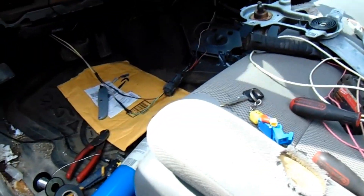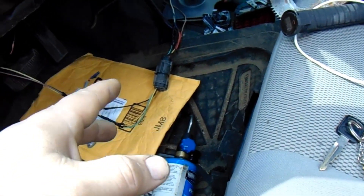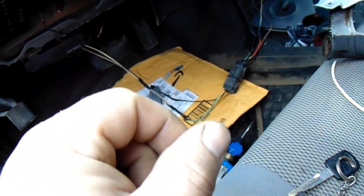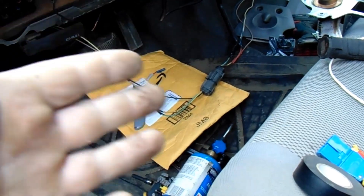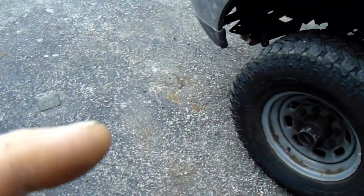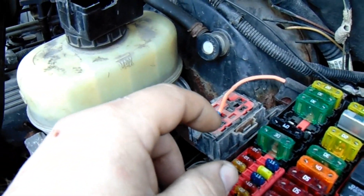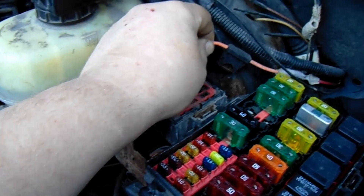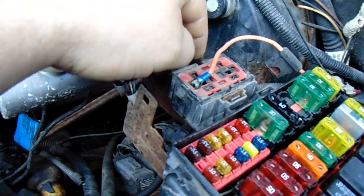Alright YouTube, she's done. Here's what I did: I got the wires ran over, everything soldered together. I used a plug for ease of maintenance later - so if I ever got to do a heater core or some stupid shit where I got to pull the dash apart, I don't have to cut the wires, I can just pull it apart and move them aside. I got that plug from the blower motor - it was thick enough gauge wire to use. Where I got power from is right there underneath this cover - I don't know what's supposed to be there, some option my truck doesn't have. That's a keyed 12-volt source with a 30-amp inline fuse.